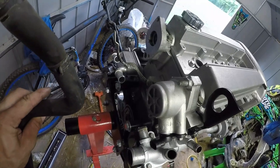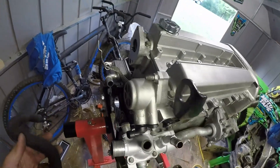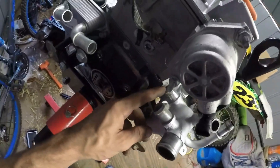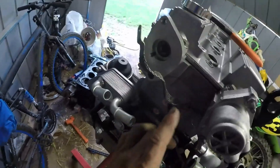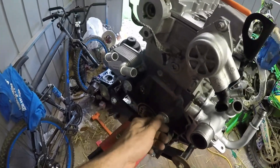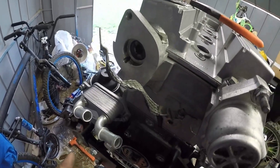I'm just going to try and mess around with this a little bit and see what I come up with — maybe I can trim it and just bend it a little bit. The hoses are flexible so maybe I can figure something out and not have to do anything major. After digging around, I actually cut the one on the backside and that one fits a little better. The only thing I don't like is it's kind of really close to where the tranny has to mount and it is touching the block, which — with vibrations — I don't really want it to vibrate through the hose. So I think I'm going to hold off on that and get back in touch with ZZP to see what they think, or maybe they can get me hoses specific for the LDK.